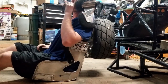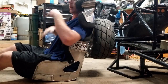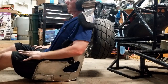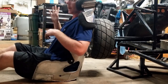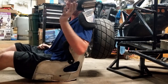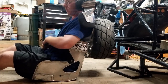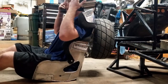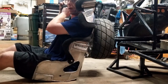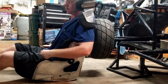From the seat you can see I still have good vision to my left side and my right side. It's angled downward - it's a sprint seat so you can see past the head support, it's not in your way. You can see the right side of the car and the left side. The left side is an inch or two shorter so you get in and out easier. The right side pad has a lot more padding because most of your force is going to go to the right side if you get an incident. It's a 10-degree layback Ultra Shield sprint seat.